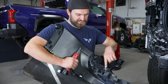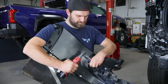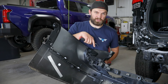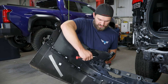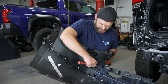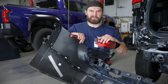We'll then remove the reflectors by pulling the two screws here with our 10mm socket. You'll save that hardware because these will be reinstalled later on. From there they each have two tabs that protrude through the fascia with a locking tab on them, so while pressing out you'll need to release that tab on each side, and that should free this up and we can set it off to the side for now.